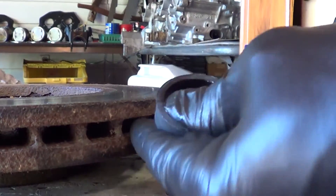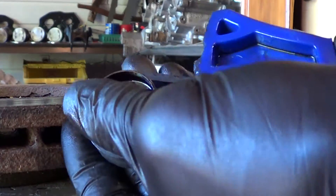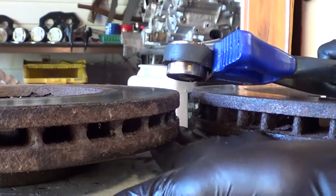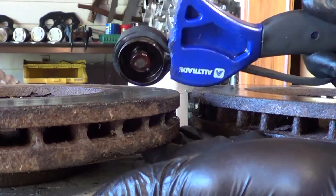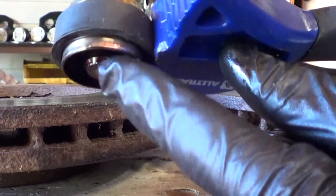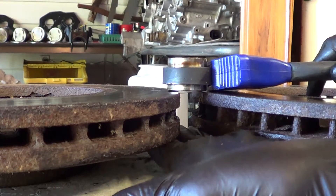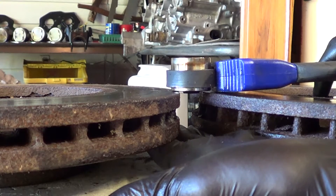Here's the lifter. What we're going to do is put it in the strap wrench — that holds it together. We're going to put our hands underneath there and tap this. I'm going to tap it and see how the lifter's dropped down — she's now flush with the body, and it's coming down.